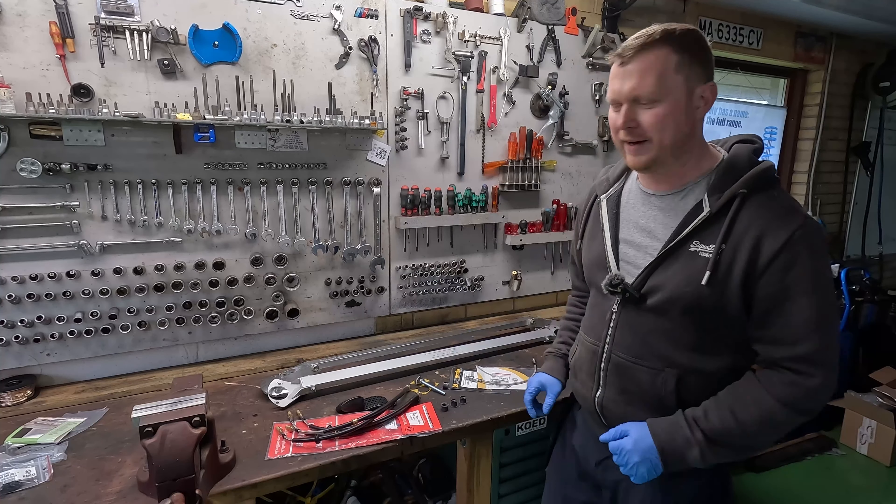Bleeding the brakes with this tool is honestly super simple and it's one of my favorite tools. After having worked with cars for many years, bleeding brakes was never really easy, but this one I actually feel like it makes it easy — it's just a cheap one from AutoZone. I always start with the one furthest from the brake master cylinder. Install a hose, have the hose higher than the actual caliper, then open it.